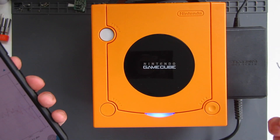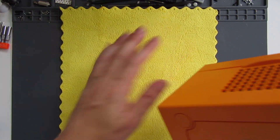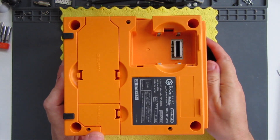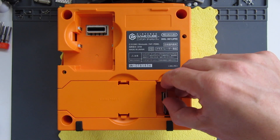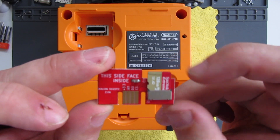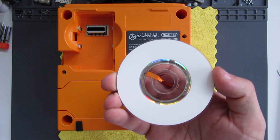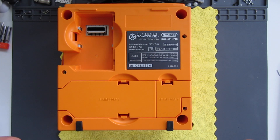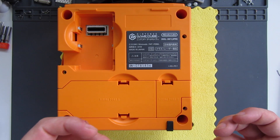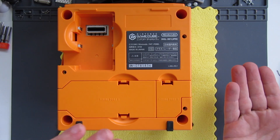Let's see how we go with the new one. So that's all powered down and unplugged. What we're going to need to do is open up the GameCube - I'll just put this soft microfiber pad down for opening up. I mentioned before about my SD2SP2: in serial port 2 I've got this little device that plugs in and has an SD card. You can save games onto there, plug in, run a bit of software called Swiss which I've got on a disc that runs in the GameCube, and it accesses a menu to allow you to load all those games up. One of the settings in Swiss is that once it's booted up and you're choosing your games, it doesn't need to use the Swiss disc anymore - so you can stop the disc spinning, which is totally silent. All you can hear then is the fans, which is what we're eliminating here.